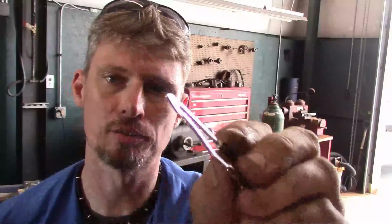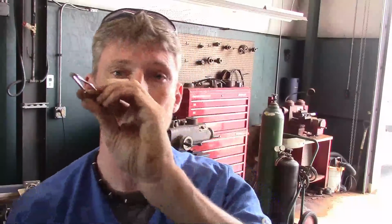Now when it comes time to cut it, you've got a couple different options. You can work with anything from a Dremel with a cutoff wheel. You can use a high wattage soldering iron with a nice little flat tip blade that would turn bright red, and you would actually be cutting into it and melting the plastic as you go around.